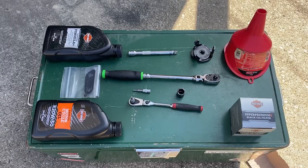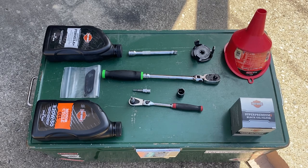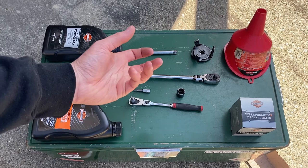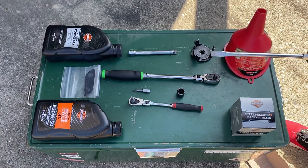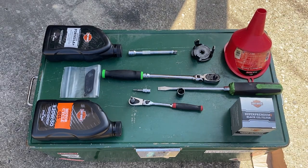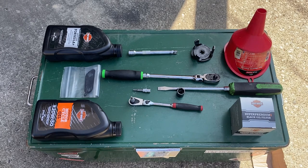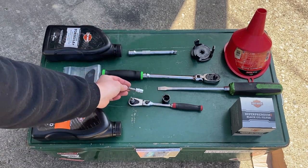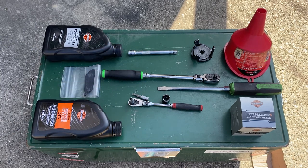The primary fluid's a little different. There's a couple ways to go about it, but all in all it's always just drain and fill. The simple tools you'll need — some can vary — but basically you'll need something to take the oil filter off with, which I have my ratchet, an extension, and an oil filter claw for a screwdriver. To take the plug screw out, and then for the primary you're just going to need a 5/8 socket and a 5/32 Allen head for the inspection cover to fill it.